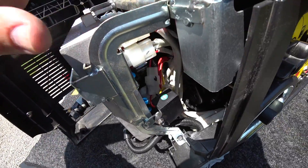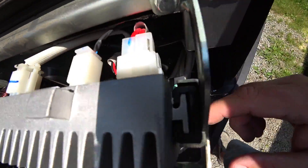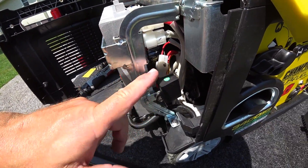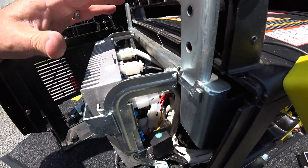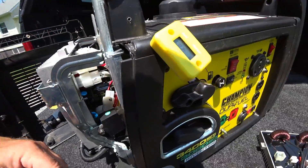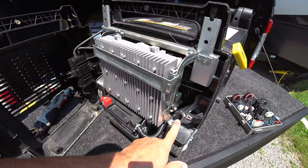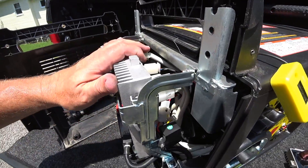Now I know which wires actually get unplugged — just this large connector down here, and then this, this, and this. You don't mess with either one of those frame wires. Once you take that one bolt out you can just slide the whole unit out, put the new one back in, and plug it in without going through the trouble of removing the frame bolts or frame supports, or for that matter the battery other than disconnecting it. Everything looks real good.